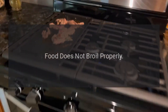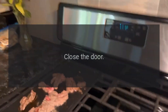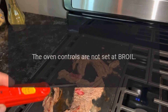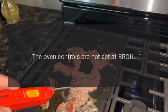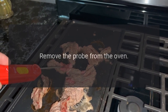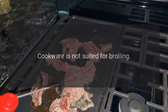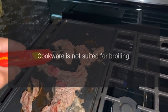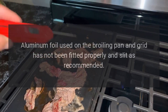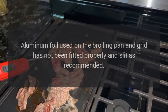Food does not broil properly. This model is designed for closed door broiling only — always broil with the door closed. The oven controls may not be set at broil. If the probe is plugged into the outlet in the oven, remove it. Check for improper rack position and ensure cookware is suited for broiling. Use the broiling pan and grid that came with your oven. If using aluminum foil on the broiling pan and grid, ensure it has been fitted properly and slit as recommended.